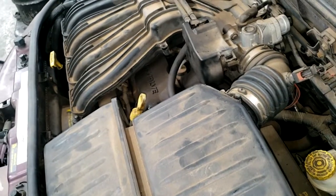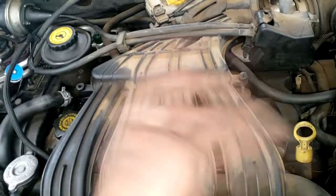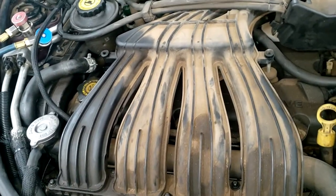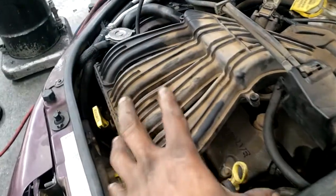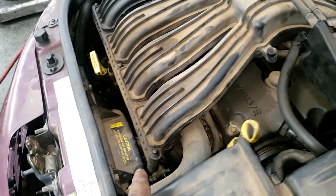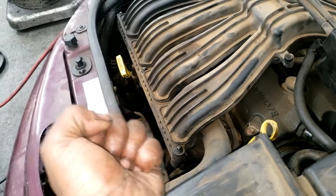I hate calling the customer back asking for more money. I've gone so far as to put parts on anyway and adjust the estimate to compensate, even losing some labor time — that's how bad I hate it. There's no way around it. The fan isn't even available through Mopar anymore, it's discontinued, so we have to call an aftermarket place. Watch this jerk right there — the fan was commanded to come on, power and ground sent to it, and it pulled the complete electrical system down with it.